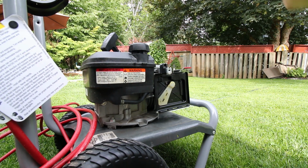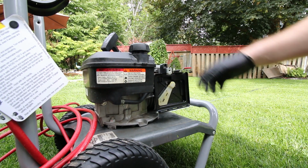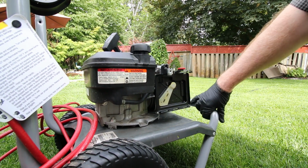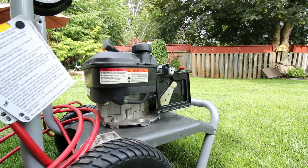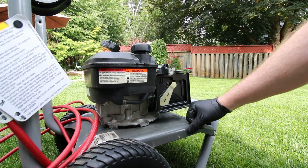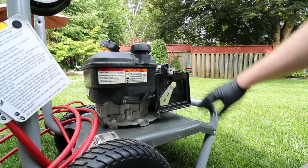That's what it was. Just a small clog. I'm assuming it was just slightly lean before. In this situation with no choke, it wasn't enough to fire it up, and now it is. This is it, I think. Try one more time. Of all the time I spent cursing this thing, it was impossible to start. It was such a pain in the ass.